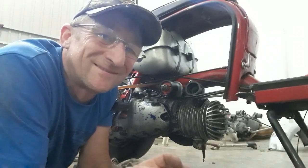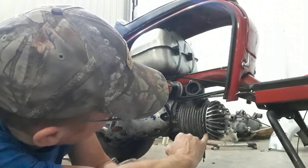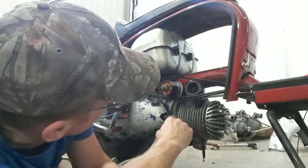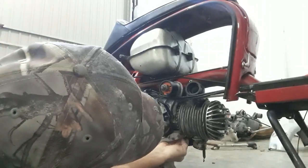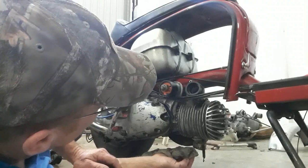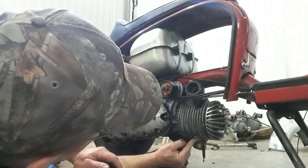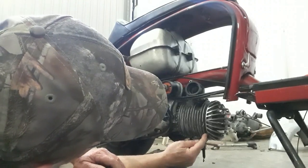Start with the right attitude. Not good — we've got a little bit of oil around here on the head gasket. It's hard to say because the carb spits out so much bloody petrol everywhere over a period of time. It's not like I've just run it and got a little bit of oil. So we're going to have to strip it down and check everything. There's no leaks on the exhaust gasket.